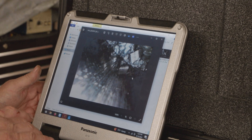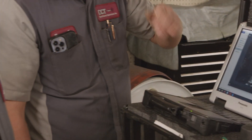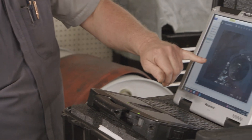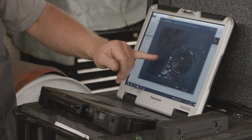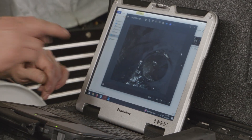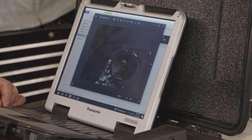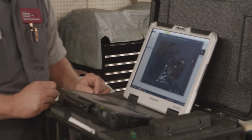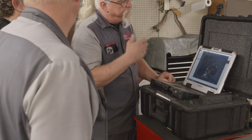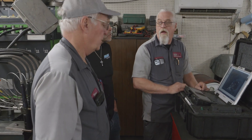That was an injector that failed — we actually came in with a failed injector that caused this problem. It's a 5.9 Cummins. At some point in time it probably got hot, dropped the seat off this valve, and you can see where it crunched it over here. It broke into little pieces and the rest is history. A bad injector causes this because it over-fuels. It's not atomizing, so it's focusing in the bowl — puddling issues and things like that.